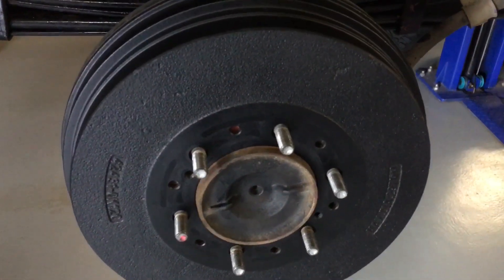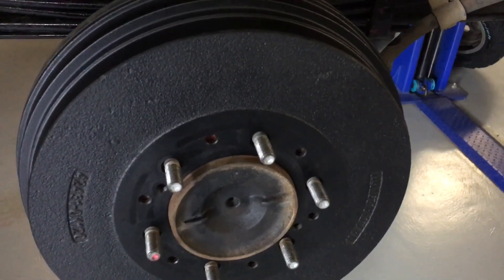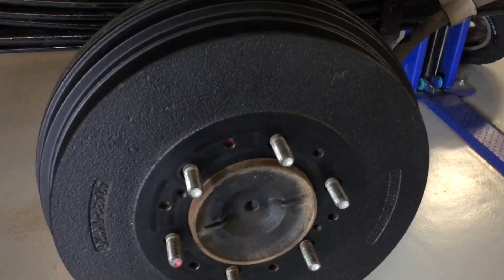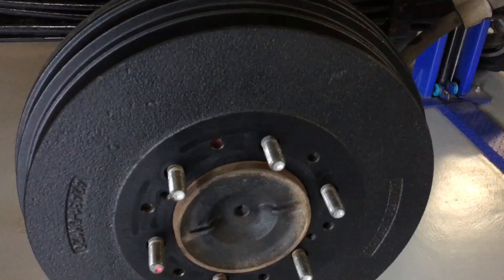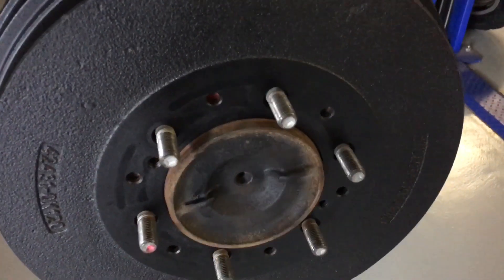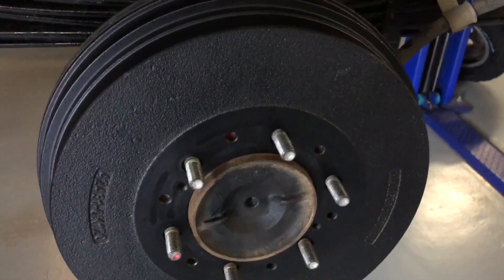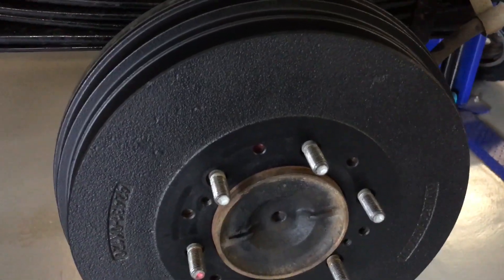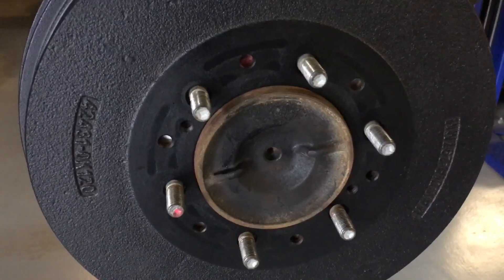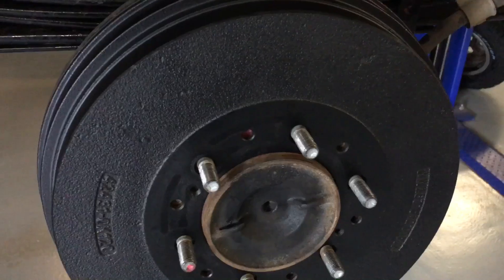Lastly, I just want to apologise to the people that now I've created work for - they've got a Hilux and they've gone and now just want to go out and jack up the rear diff, take the wheels off, get the drum off, and have a look what's in there. Because those bog holes just fill it up with mud and wear it down. A lot of the information from this - getting drums off - is very similar on the rear of the Prados. They've got a handbrake shoe setup in there. You may need to back off the adjustment - on those it's done through the holes at the front and the bottom, different to this but very similar information. That's what pays to just watch all the videos to the end, take it all in, and try to understand all the systems so you can work it out yourself and overcome the problems when working on the vehicle. How good do those drums look now - bloody beautiful! Thanks for watching guys, subscribe, turn the bell on, smash the like button if you liked it - see ya.